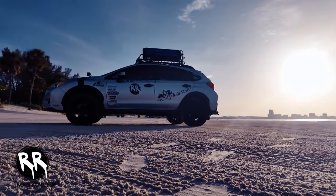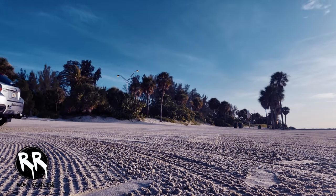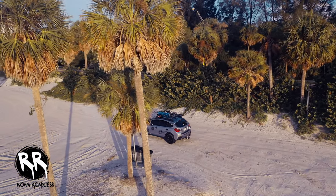Now you are able to go off-roading with both of them. It's really dependent on how deep into off-roading you want to go and how much pressure you want to put on your car. For your typical off-roader — if it's your daily driver and you're just going camping and whatnot — a spacer lift is probably the way to go. But if you're really trying to go mudding in places where jeeps go, you're going to want the spring lifts.